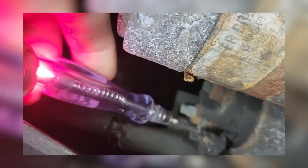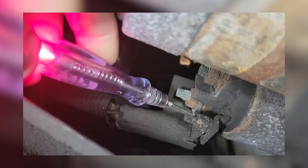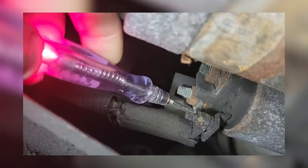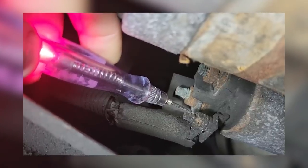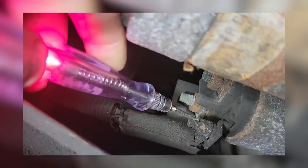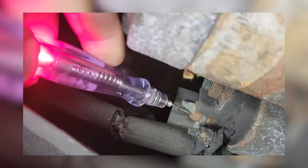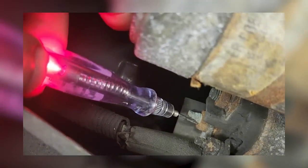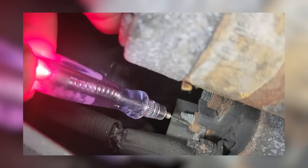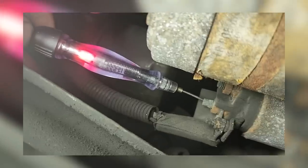Let's talk about a few mistakes you can make here. Mistake number one: don't go to the eyelet first. If you went to the eyelet first and it stayed lit the whole time, it would tell you that you basically needed a starter motor. Make sure you go to the stud — the stud is what the starter is going to see. As you can see, you can have a voltage drop problem in between them.